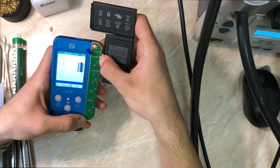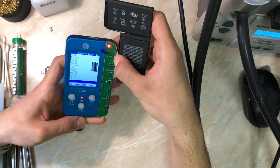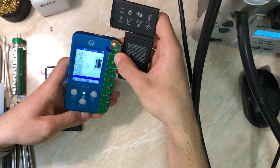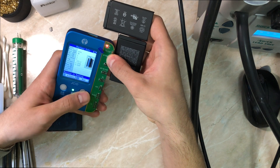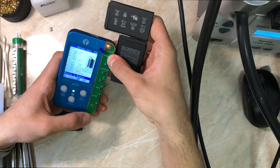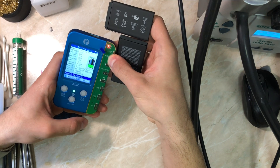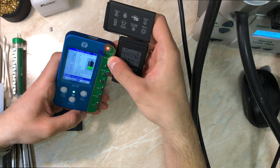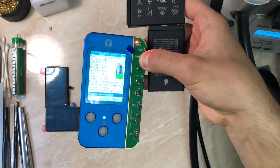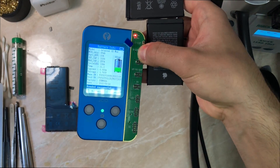The programmer is used to reset the cycle count and battery health. Now, on iPhone 11 and up, the EEPROM on the battery board is encrypted, so it can only be read or written via special methods. Companies like Canifly and others have made an individual flex with an IC that connects to the battery connector to store the battery data — but that is for another video.